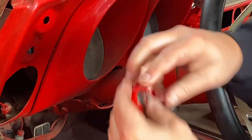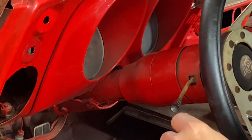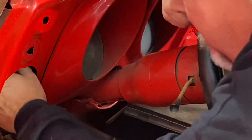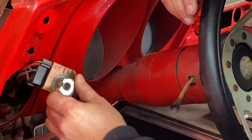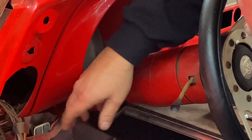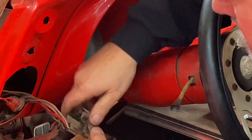So that goes together — this slips right in there and it says 'lights' at the top, but of course the paint's covering that. Now let's reach up in there and grab that light switch and pull it out. 50-plus years of Oklahoma dirt and dust. Just give it a look, check on the wires, see if there are any damaged wires — like a rat's chewed on it or something — just to figure out why we don't have brake lights and tail lights.